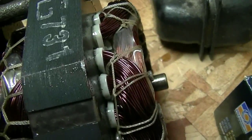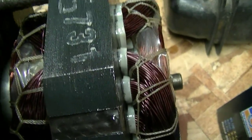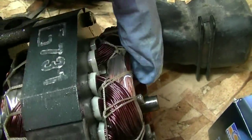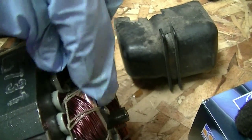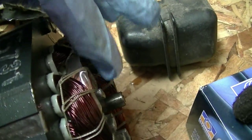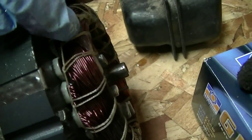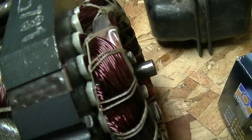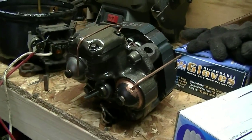You see here's — this is a split phase motor. The start windings are here and the run windings are these big ones. What it does is — this relay controls it so you don't want to keep these start windings energized, because if you do they'll burn up. So the job of this relay is to cut those windings out so the run windings can keep this thing running. If you want to learn more about that, just look up how induction motors work.